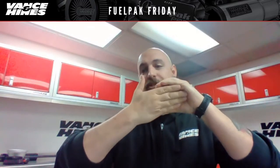Do I know about Jekyll and Hyde exhausts? Yes, I do. Is VH going to come out with something similar? We've kicked around the idea. So Jekyll and Hyde, for those of you who don't know, is an exhaust that has a, how do I put this, a solenoid actuated butterfly valve. So basically it's an exhaust that's normally wide open, but there's a butterfly valve. You push a button on the handlebars and the butterfly valve opens and closes as need be.